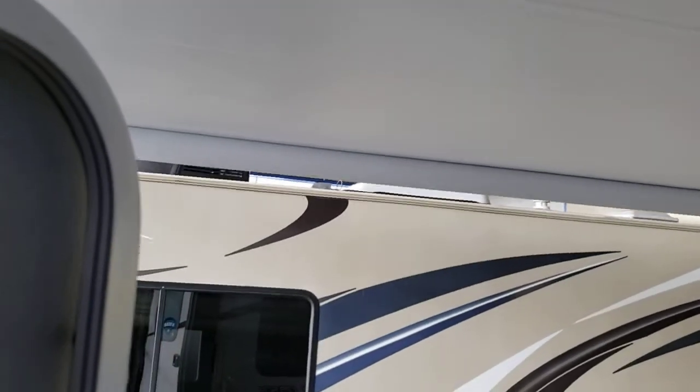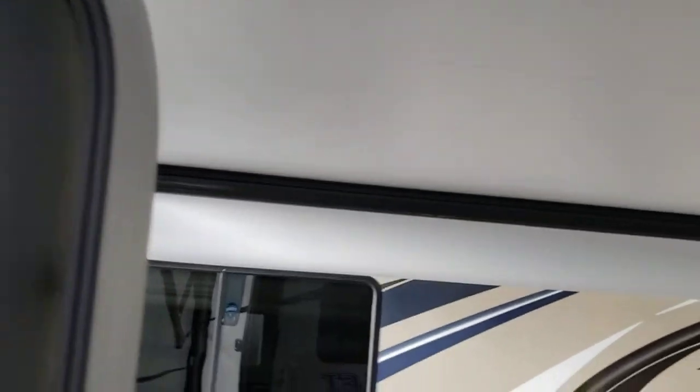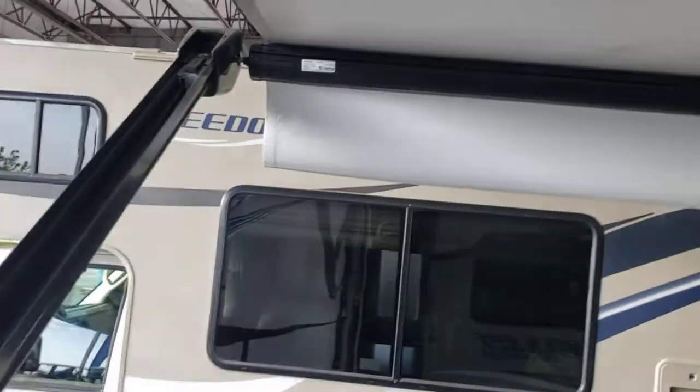The awning light switch is right above it. Make sure you don't have your door all the way open when the awning is out, or you risk bending the awning arm or scratching the door. They do not stop automatically when fully extended — you have to visually look. When you see that bare tube and the flap hanging vertically, you're all the way open.